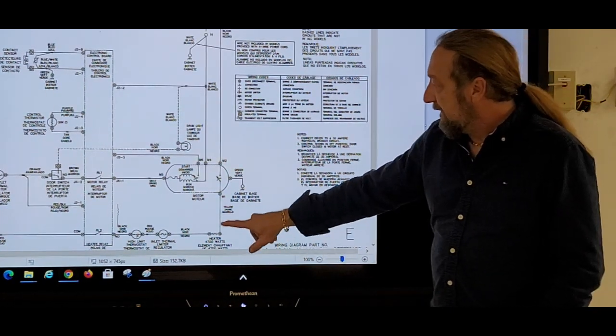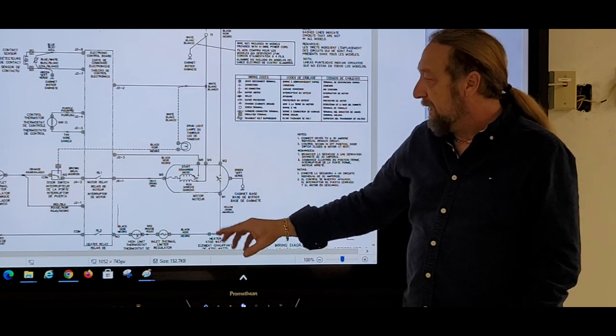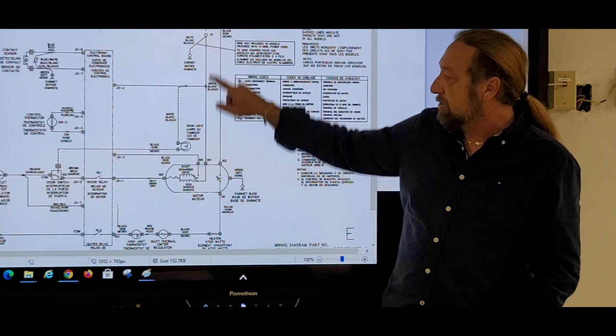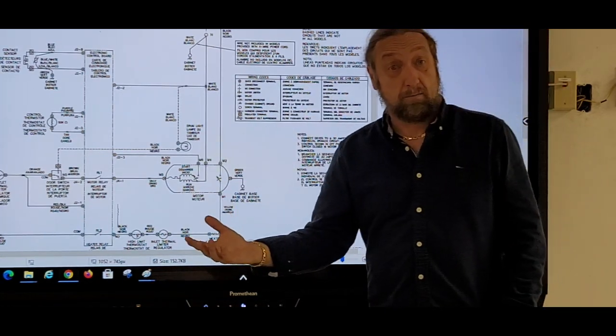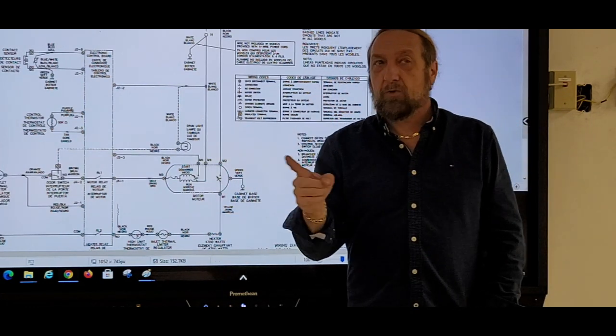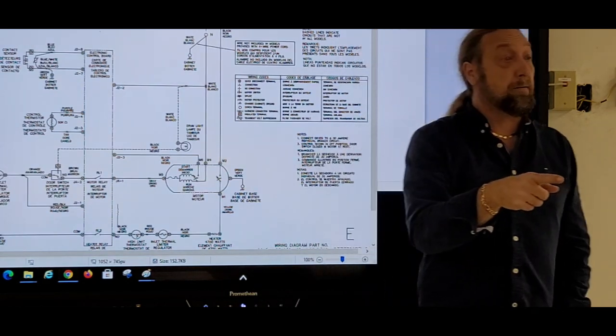Okay, so it does go through the motor here and go out to line two, but the motor itself, these are the windings in the motor, they go to neutral. They take 110. We know the board lights up, so that means what? You got power. You got 120. You got 120 board, but what else do you know by that?